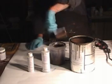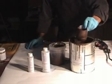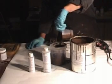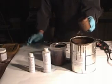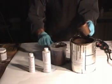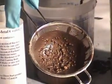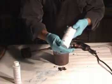Anytime you're using these metallic paints in a sprayer, it's very important to strain the paint to remove any lumps that might clog your sprayer. Here we're using a stainless steel strainer to strain the paint base before we start. We're measuring out about 16 ounces, and that amount will correspond with the tick marks on the side of the hardener bottle and the catalyst bottle. Ron is showing all the little lumps that were hidden in the paint — if we hadn't strained it, that material might clog our spray gun.